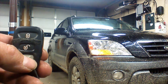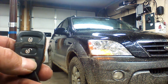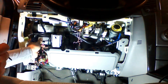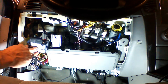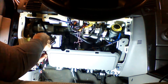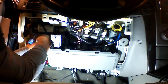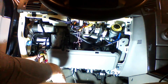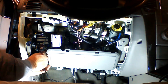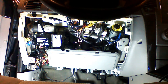This is what it looks like with the parking lights connected. Remember, the remote doesn't work while the engine is running — you have to get in with the key. We've disconnected a few things to do wire routing and make everything look nice. We're going to mount the unit up in this bracket area using a 14-inch zip tie that comes with the kit, without fully tightening until we're done, since we still need to access plugs on top. Then route the wires over and plug them back into the Evo so everything is nice and neat.